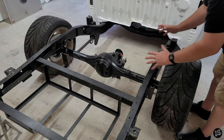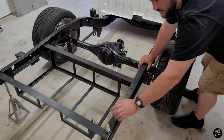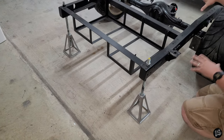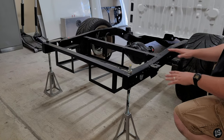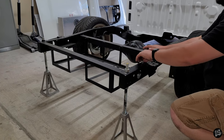The first thing we're going to do is get a good reference frame of where everything needs to be unsprung. The truck is on our stands and what this is doing is taking out the unevenness of concrete - concrete looks really flat but it's not always perfectly flat. We want the frame leveled up in the air with an iso center to go off of.